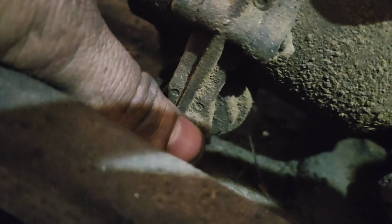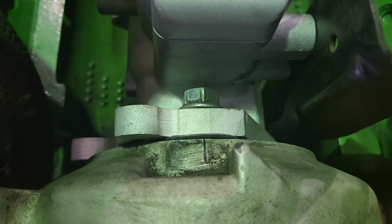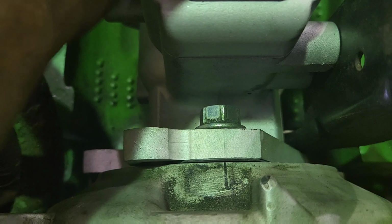On the bigger pumps, they get away with all that. So you just have static timing, which is what I was showing you with advancing that one tooth. And then up here on your timing marks, here on your front cover, this right here would be 0 degrees. And like I said, on the Chevrolet application, towards the driver's side is advancing. Towards passenger is retarding the timing. Even with that one tooth skipped, we're probably gonna end up fairly close to like there.